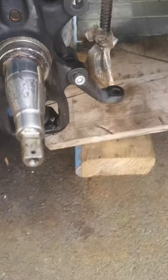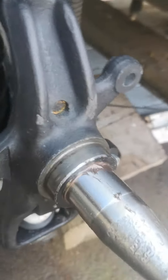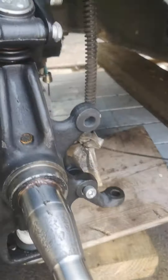Let's come out here and have a look on the car. These are the front stub axles, as you can see. I've already fitted them. These stub axles were sent away, they were machined, they were hard chrome plated, then machined down to size again. They've already been fitted, both sides, front and rear.